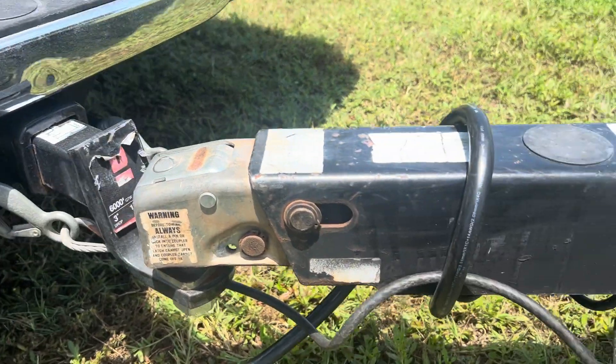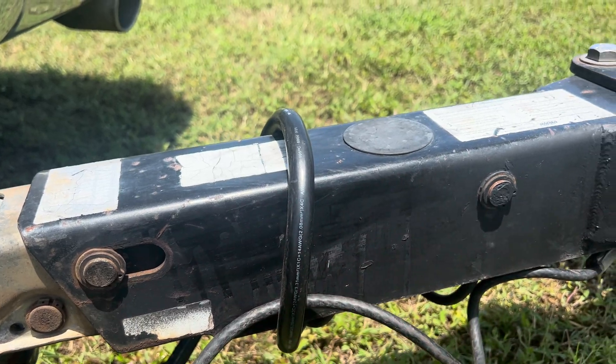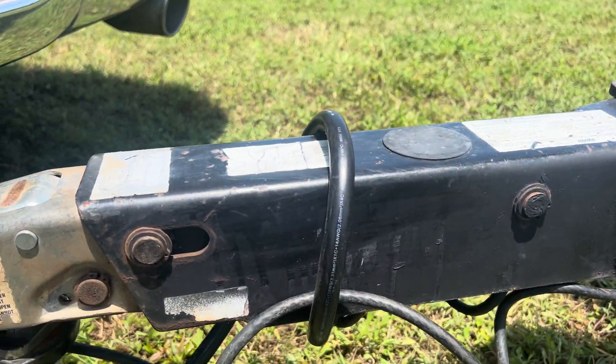So, if you don't have that solenoid to do the loop-back and lock up on the brake fluid, when you try and go in reverse up a hill like I'm doing here, it'll stop the truck and the trailer, and you'll just be dragging.